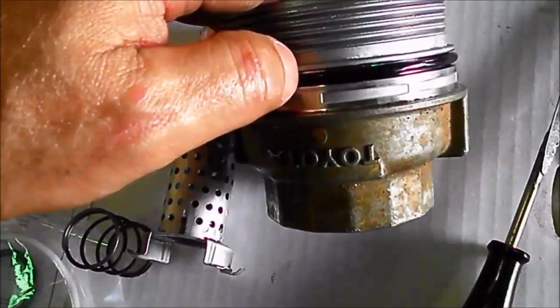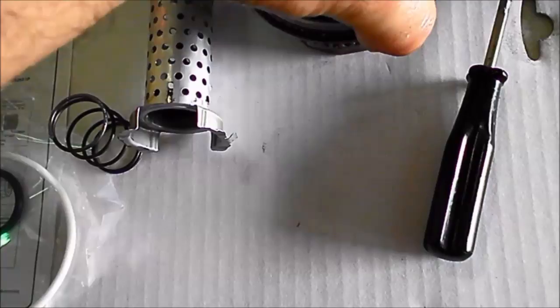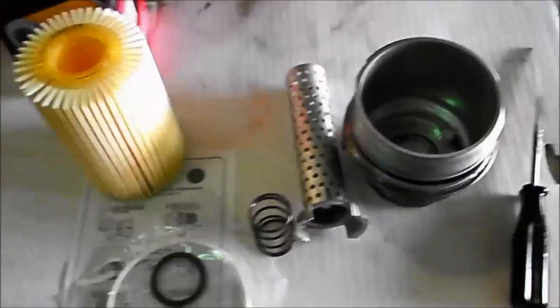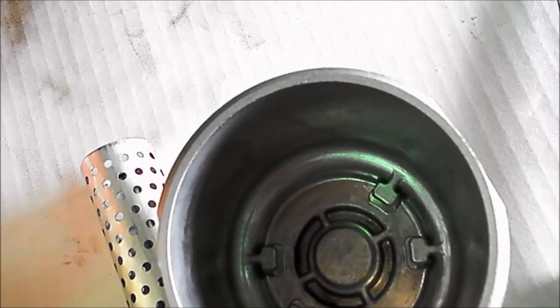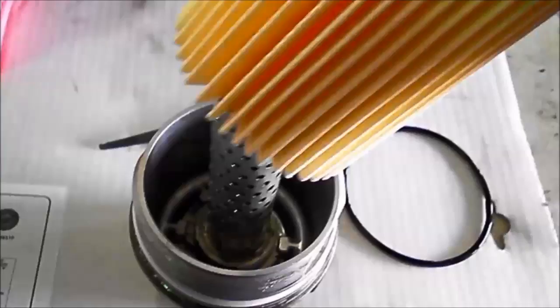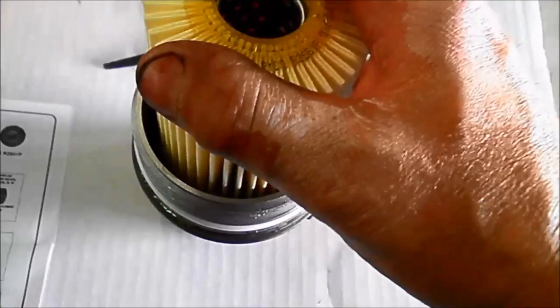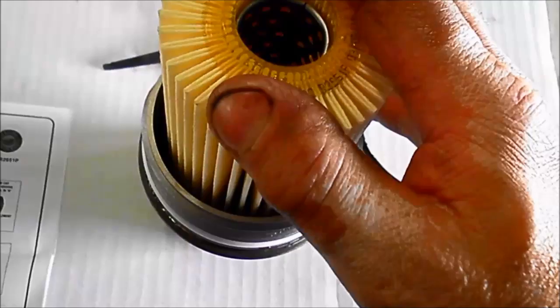We're going to replace this little o-ring that comes with the filter kit. When you tighten it, just tighten it up — the rubber seals pretty well. This unit, when you're putting it on, just twist into those slots. You put it in and a clockwise turn and it'll go into where it should locate. We've replaced the o-ring and popped the filter back on — and you can see if you push it down it will actually move, which is a safety feature. If the filter becomes completely blocked, the oil pressure will push it down and let the oil circulate around.